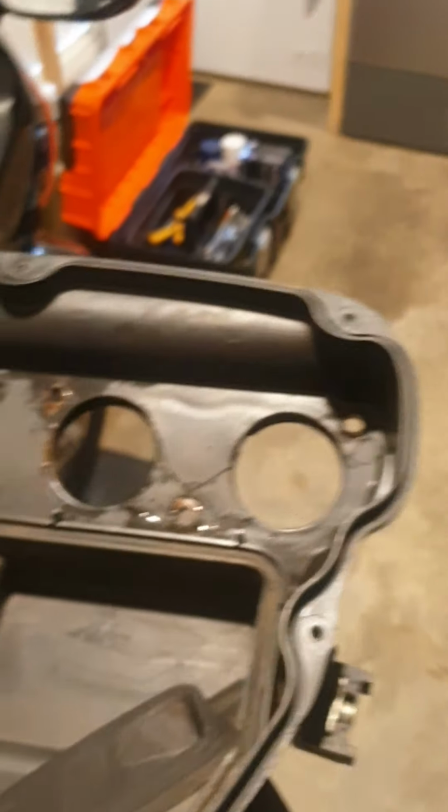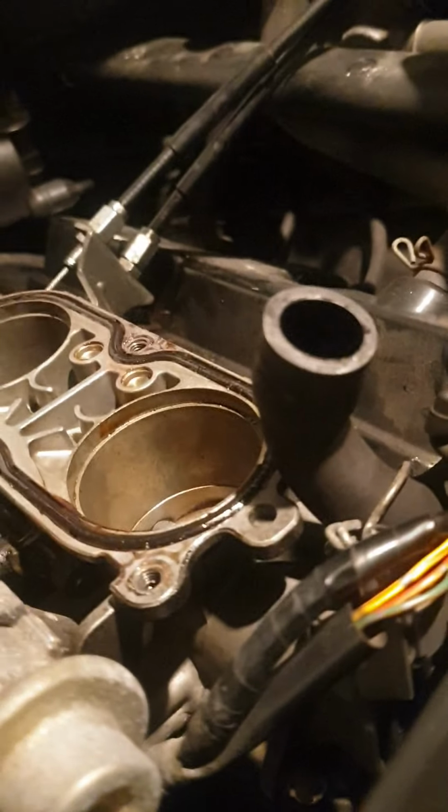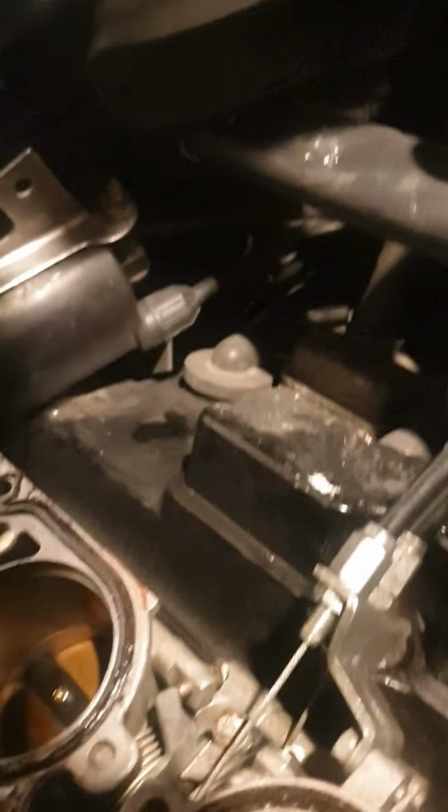Okay, that's the bottom of the airbox off. Pretty straightforward really. The air ducts, this one and that one there, and that pipe, come off pretty easy actually. I just slid the airbox back and it pulled it off. The tricky bit, I found, is this pipe here, which went on this corner. That took some getting off. I had to get a big screwdriver and just lever it off. But now you can see I can get access to the plugs. So that's basically it.